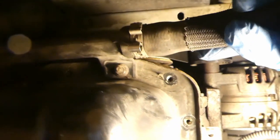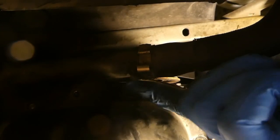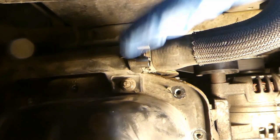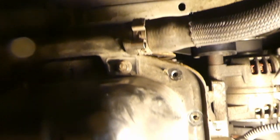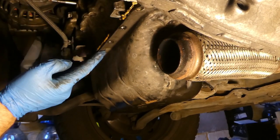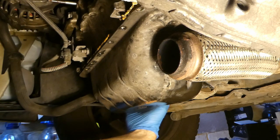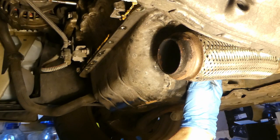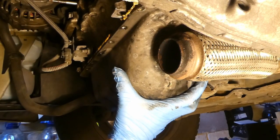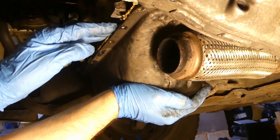Here is the sump and I've removed every single bolt possible. I'll go around with a finger just to try to see if I've removed everything and haven't left anything out. Even if you move it, you can't really prise it open. So I have a small putty knife to try to wedge in here and try to undo it. There are quite a few bits and pieces here from the previous gasket - remove those. The easiest point is to wedge it from that side.